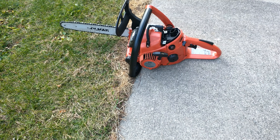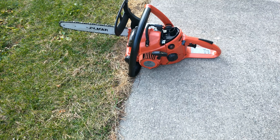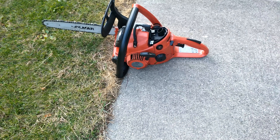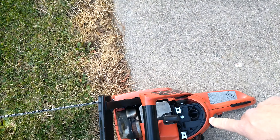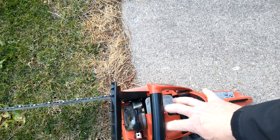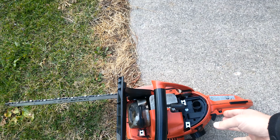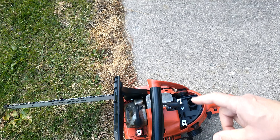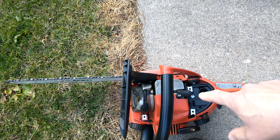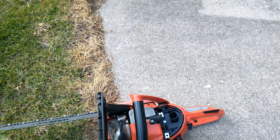Hello and welcome to Just Be Handy. I just bought this chainsaw off Craigslist and I've been having issues with it flooding. I'll try to start it and show you how there's fuel that kind of back-flushes through the air cleaner. I have the air cleaner housing off on this Dolmar chainsaw, and we'll see what happens with the spark plug — the carburetor is just not running right and it meters a lot of fuel through here.